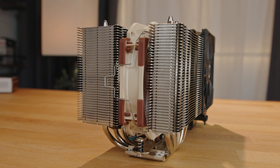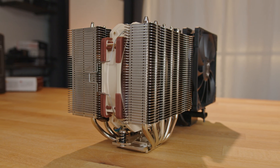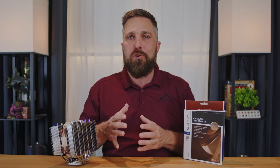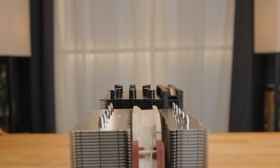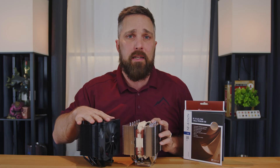Next is size-to-cooling ratio. This is a relatively small cooler but it's still capable of cooling almost every retail CPU available. The only issue I can foresee in that regard is the motherboard — while this cooler should definitely handle a stock i9-12900K, some motherboards allow the 12900K to draw up to or over 300 watts, which I will venture to guess is a bit more than this can handle. While the 145mm height is great for small form factor builds, most enclosures that can handle this 145mm cooler can also handle a 154mm cooler.